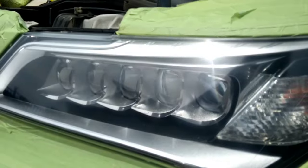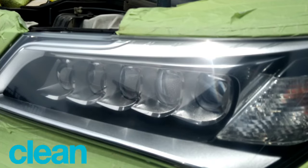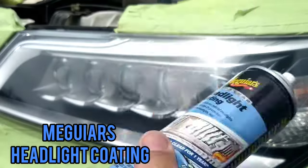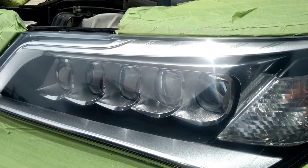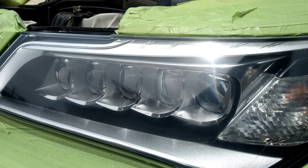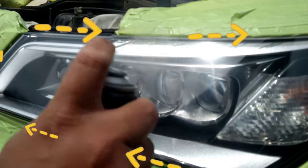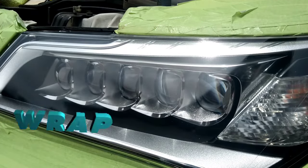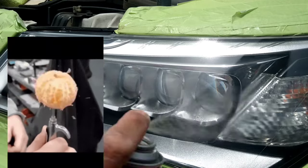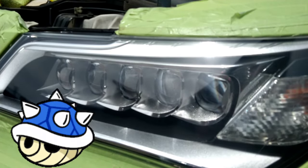Very important on this step to have a clean microfiber towel. You don't want to be rubbing oil or old deposits on the surface. This is partially why I blow around the area to make sure there's no dust and use a clean microfiber towel on this part — I have hundreds of them. This is Meguiar's headlight coating. I like to use this one; it's a very good coating. You always want to start on the outside rim, shooting it in between the cracks. You want this coating to wrap it like a blanket and hit all the areas. If you don't hit these areas correctly, in between the lights, you have a peeling hazard. I always start there and then fill it in, which helps it form a shell around the whole headlight once it starts drying.